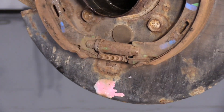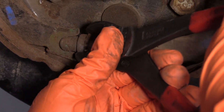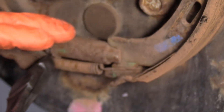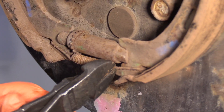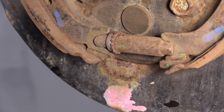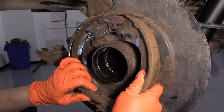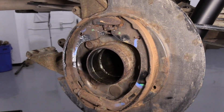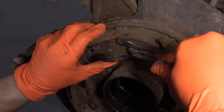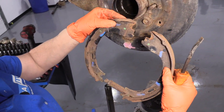There's a spring in the back and a spring in the bottom. I'll do the bottom spring first — it's below the adjuster. The adjuster could be frozen, but I'm replacing it anyway. For the price of the hardware, the adjuster comes with the new hardware kit from 1A Auto. I'll replace the springs and adjuster. Force that spring out of there, then take the shoes apart. Now take a small pry bar, get it up in there outside of this ear, pry the shoe past that — and now there are your two shoes with the adjuster. The adjuster is frozen on there, so it won't have the free motion it needs when you use your e-brake.